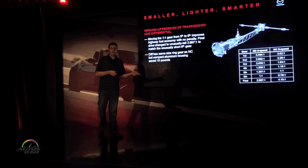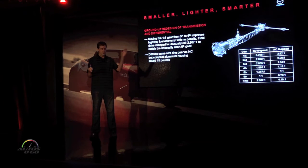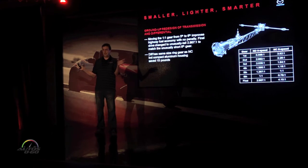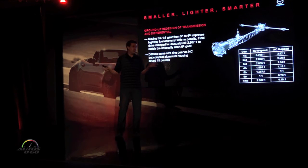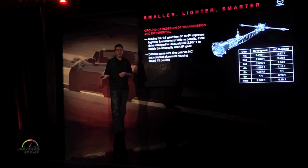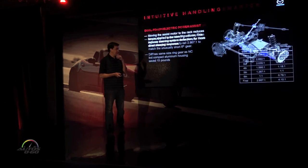Now that sixth is one-to-one, we had to change the final drive ratio, because your total gear ratio is your transmission gear times your final drive gear. If we made the transmission really short, we need to make the diff really tall. So we went from a 4.1 final drive to a 2.8. That big a change wouldn't fit in the old housing, so we redesigned the diff as well.